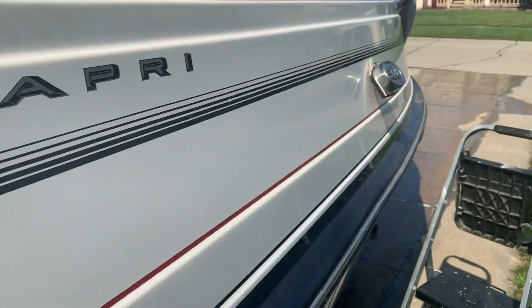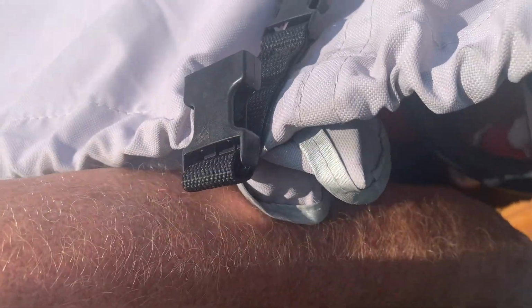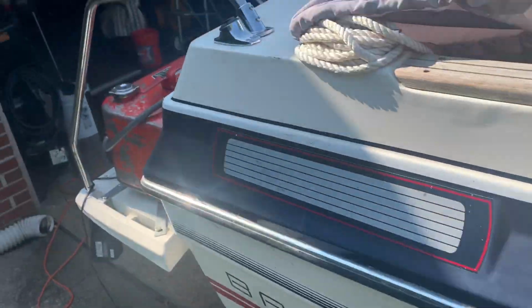It's on low idle. I might have to adjust the carburetors just a little bit. I got them set at factory. I think it's 1 1/4 turns out. Let's see. I pull this lever. I might have to back it up a little bit and then move forward. Then you can give it throttle. Got it at high idle. That's warm up.